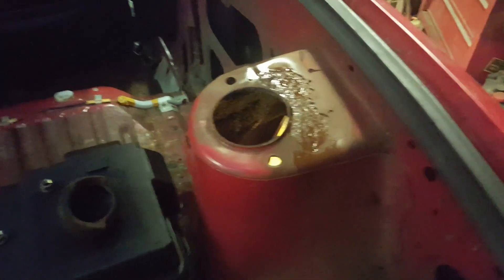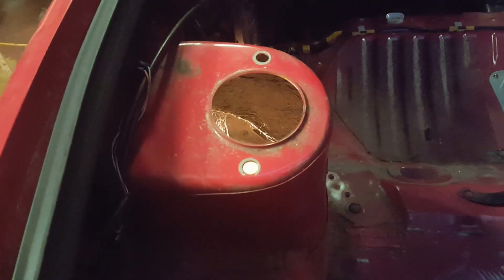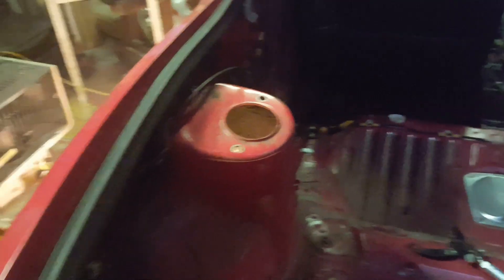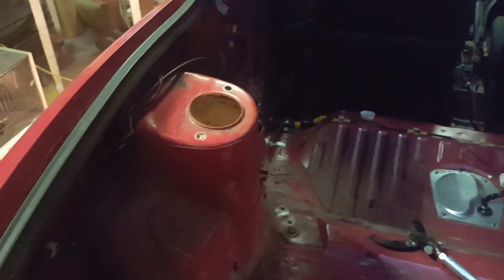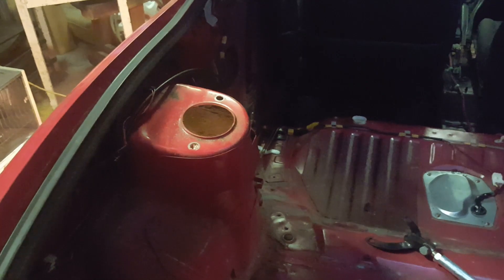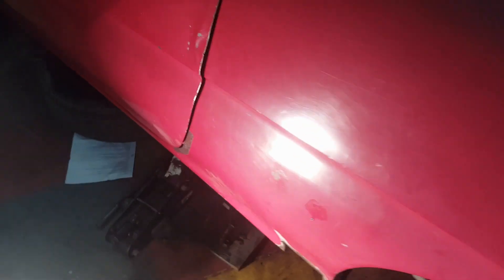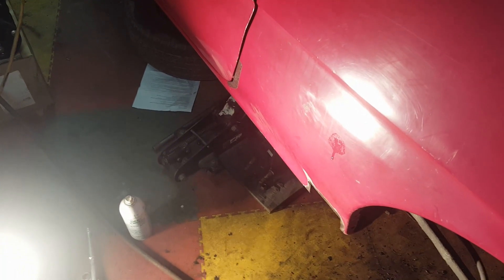The primer I put on heavy is still drying — not a problem. This side, as you can see, is not going to need priming or wire brushing; both the inside and outer are in pretty good shape. I'll switch it up and install the driver's side now. One of the things I want to do is wire brush off the hardware, which is a little rusty, and that should make reassembly cleaner. I'll bring you back when those are all clean and have anti-seize on them and everything's ready to go.